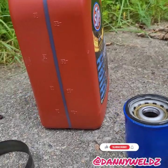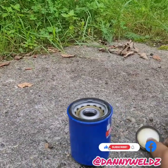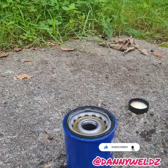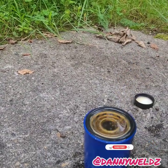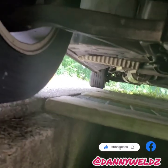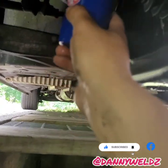We're also going to fill the oil filter up with some oil so that when you start the engine for the first time it sucks up some oil and doesn't get a dry start, as they call it. I like to fill it about three quarters of the way. Then we're going to go ahead and place it up where it belongs.